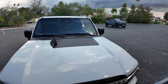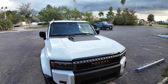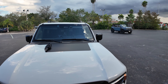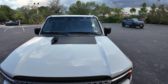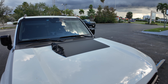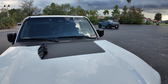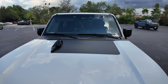You may have heard the thunder in the background. I needed it to cool down and needed the overcast, so I was going to wait till late in the afternoon — but with all the clouds in the sky right now, this might give me the break where the hood is not that hot. If it starts raining I will stop the installation and maybe continue it at home under cover. You never want to do these installs under direct sunlight. It'll heat up the vinyl, the vinyl will stretch, and it'll be really weird when you're trying to squeegee it out.